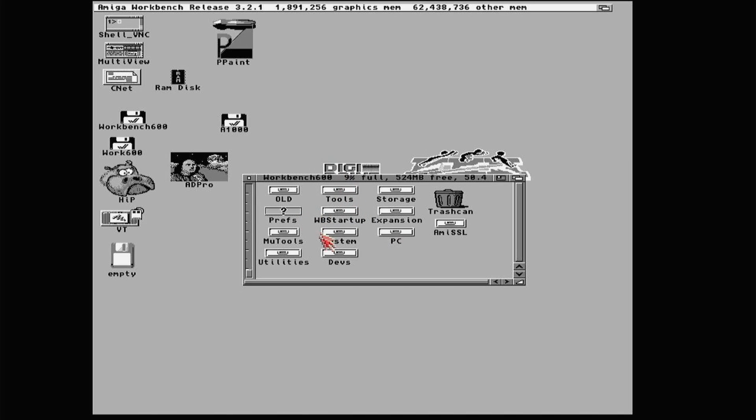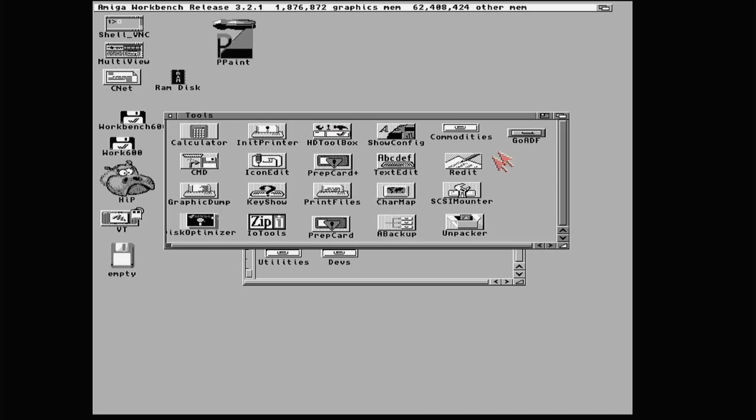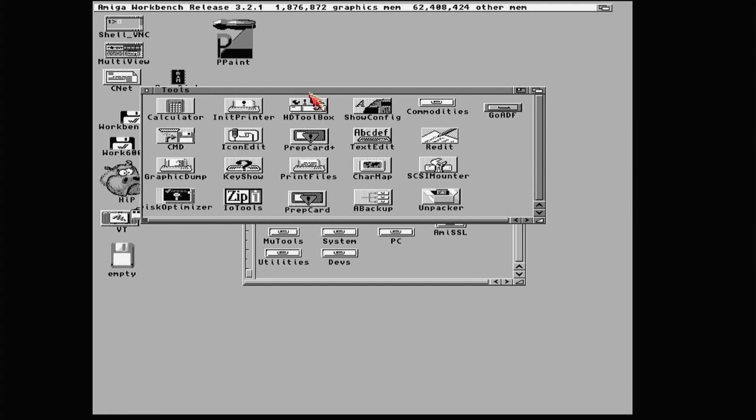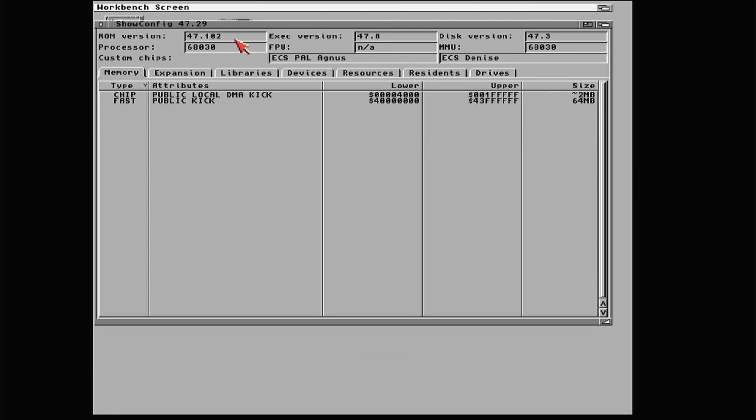When we're using something like the Furia and we're trying to use PCMCIA, we can't use the full 8 or 9.5 megabytes of memory on the Furia. We have to use either 4 or 5.5 megabytes because the Amiga 600 uses the address space for that upper 4 megabytes of memory for the PCMCIA socket. 32-bit memory, we don't have that problem.